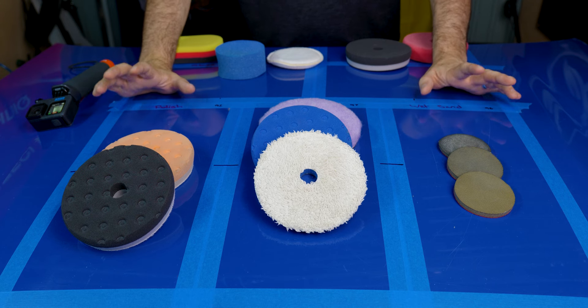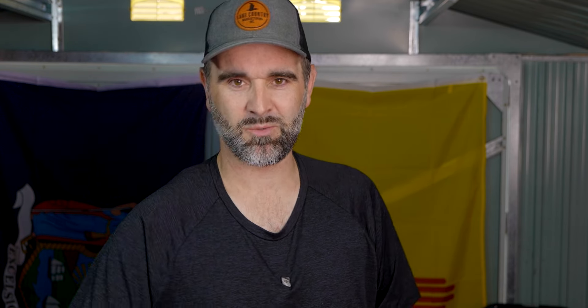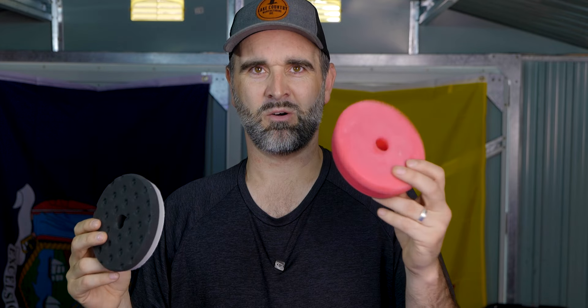Over on the test panel we've got a few sections taped off. Let's quickly talk about some of the pads you may end up using. When we talk about polishing, you're talking about the final step. This orange pad is a one-step pad - you can normally cut and finish with it. Then we've got the black pad, which is a finishing pad, and a little red pad which is another finishing alternative - super soft compared to the others, but both are finishing pads. The orange one is used for swirl removal, and the black one is for the final jeweling to get that high gloss from the paintwork.